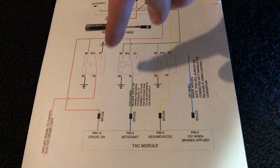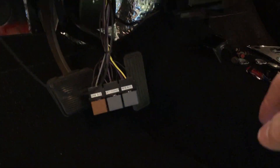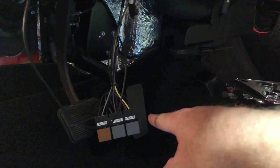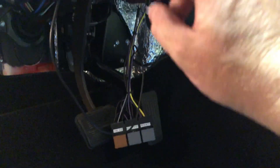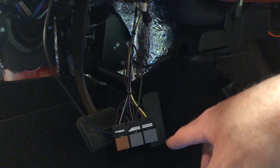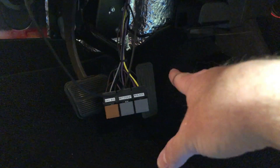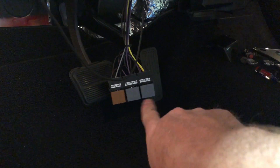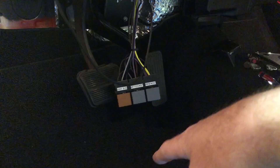I added an extra relay that gives a ground signal when the cruise system powers on, which triggers the indicator light on my dash. I've got some extra wire I'll loop up into the dash to keep it serviceable. There's not a lot of room under the dash but I'll zip-tie it up, put loom tape on it, and use high-strength velcro to mount the relay block to the side of the wiper motor box — mounted upside down so you can access and pull the relays from below.